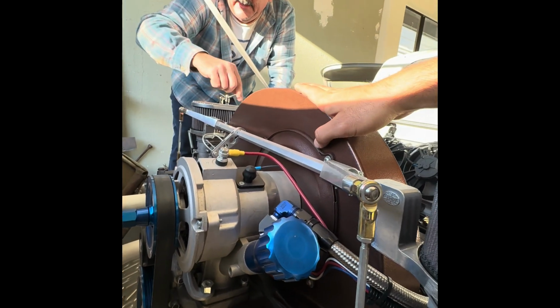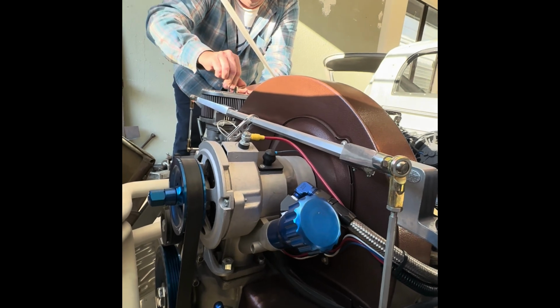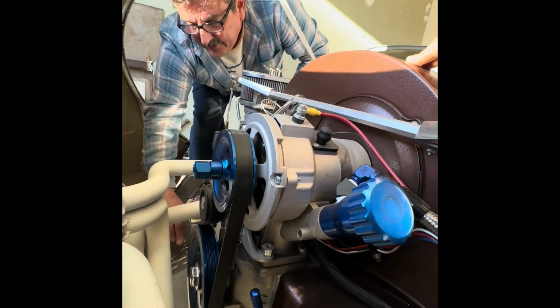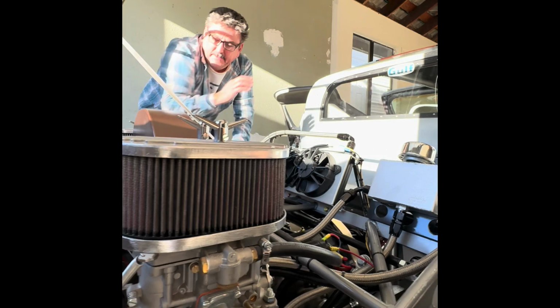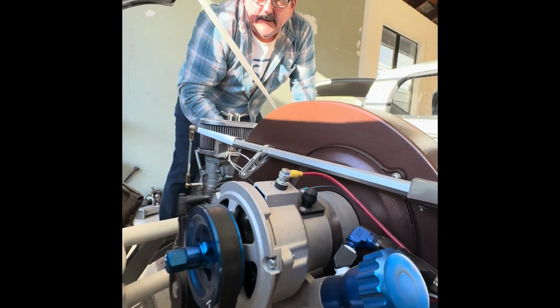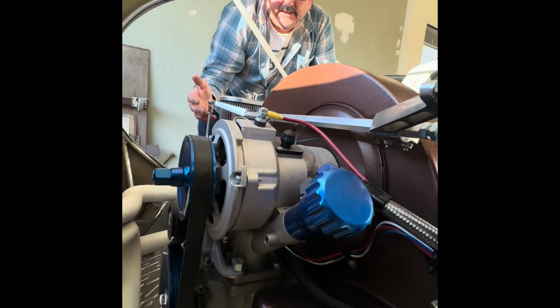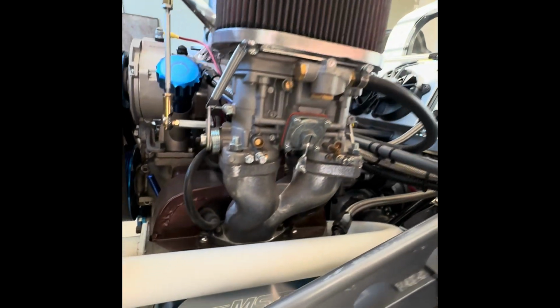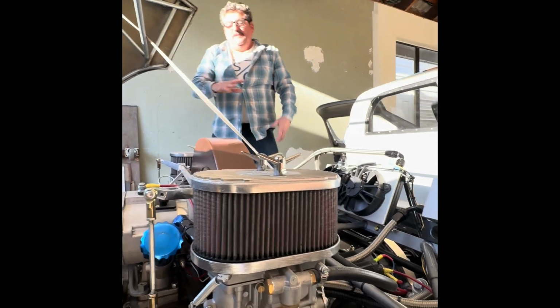I custom built all the exhausts. This is all for oil pressure, right? That's just the oil filler. Right there. Oil filler. Right. This one is hot. This is the oil pump down here, and see that all comes this way, and goes through the cooler, through the oil filter, and then back. What kind of ignition system? Electronic. So it's electronic, not the old school stuff with resistors and all that kind of stuff. So anybody that knows anything about these engines, they'll know. It's all done.